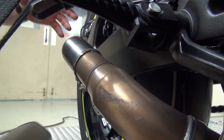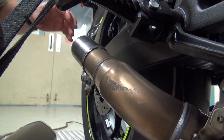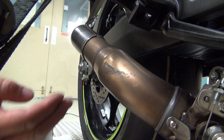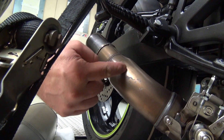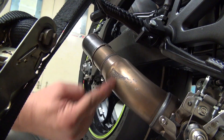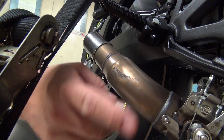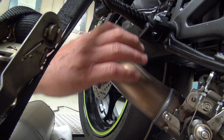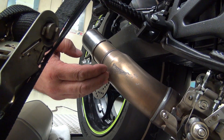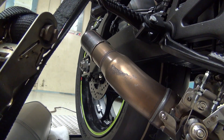What's the difference between a slip-on system, a cat delete system, or a three-quarter system? On the ZX10R: if you keep the cat installed and put a slip-on muffler, that's a standard slip-on. If you remove the cat - you can see that honeycomb in there which is certainly more restrictive than no honeycomb - and replace it with a free-flowing elbow pipe out to a free-flowing muffler, that's a much straighter path. Those two components together weigh over 15 pounds, while the muffler and titanium elbow pipe weigh about five pounds - a significant weight savings. Since most of the restrictions in this exhaust seem to be from here forward, we made a phone call and we think we can find the answer to that question. We're going to check that out next.